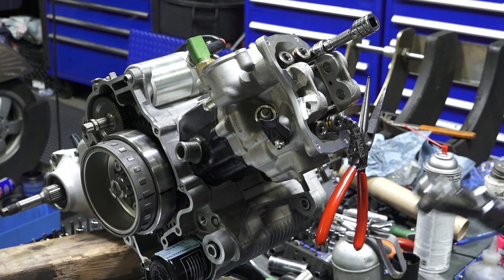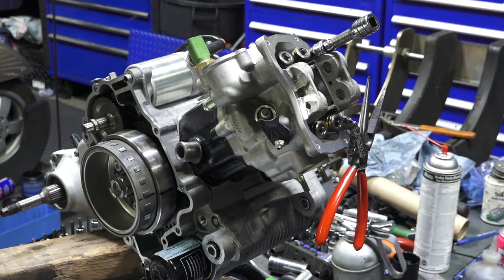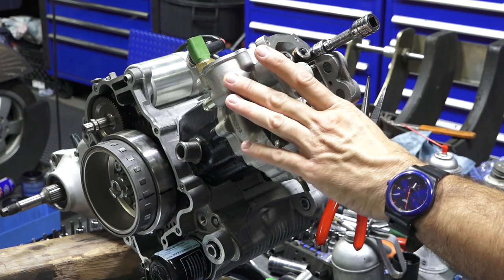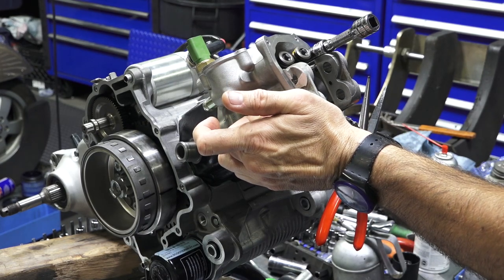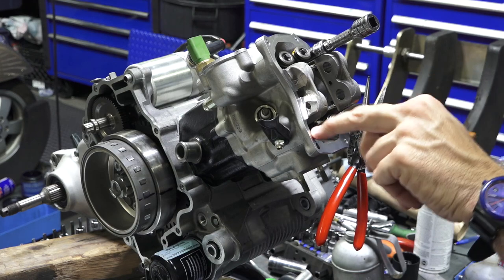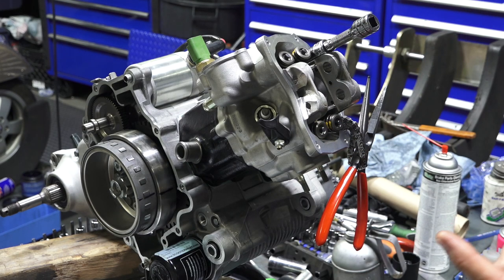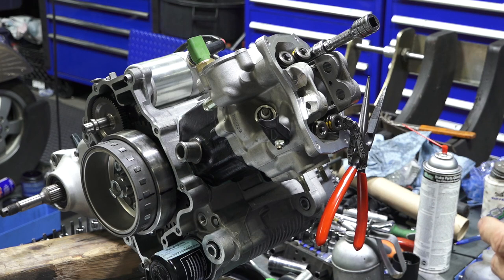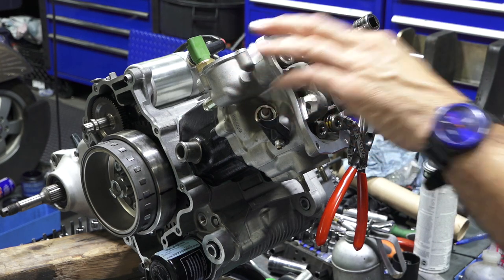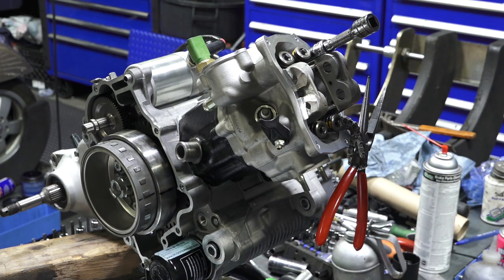With these studs, if they are brand new studs, there's a different torque sequence for brand new studs versus used studs. For new studs, you want to torque each of them, all four of them in a crisscross, to 7 Nm the first round, then a second round at 10 Nm, and then you'll have three rounds of 90 degrees. So a total of 270 degrees on each of the nuts divided up in three steps. And I'll show you how to go about that.